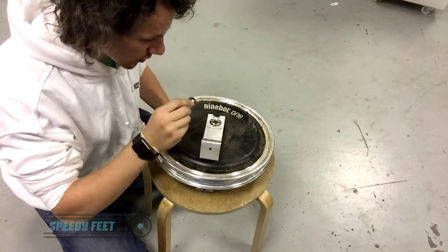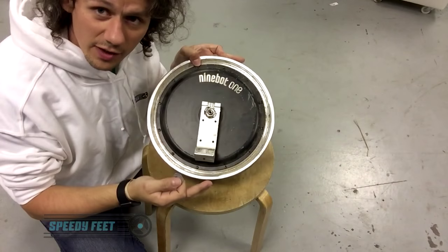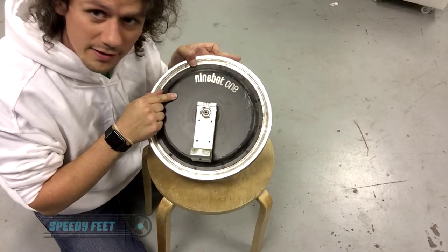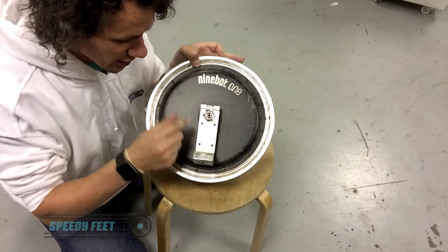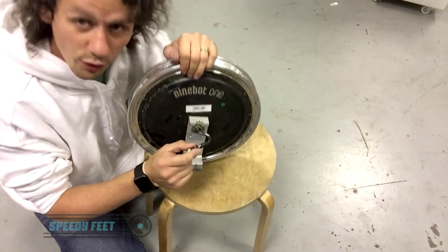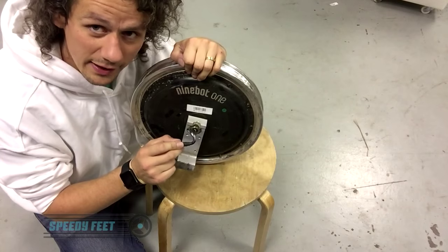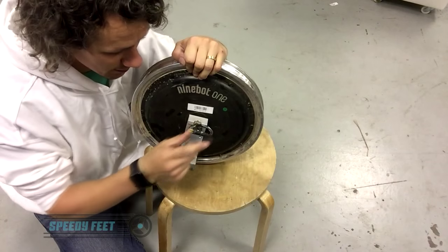This two-mil washer will sort that out. All you need to do is get it down to this stage — not as far as this, go and see a previous video. It can be on either side but it is predominantly the right-hand side in three cases out of the hundreds I've had. The other side has a cable running through it, and a standard socket — the connector won't fit through the end of a standard socket. If you feed it through and put it on, there's nowhere to put the wrench because the cable comes up through the centre.